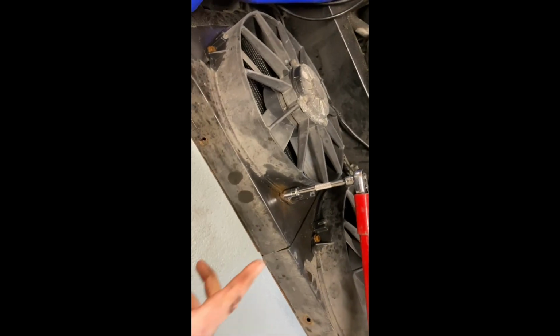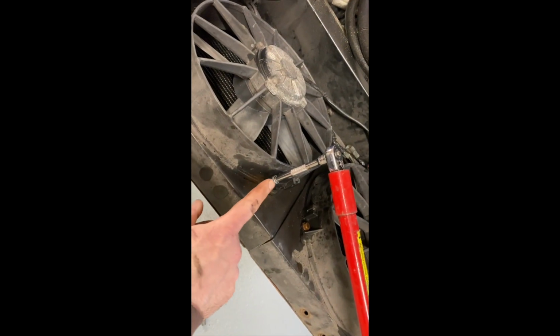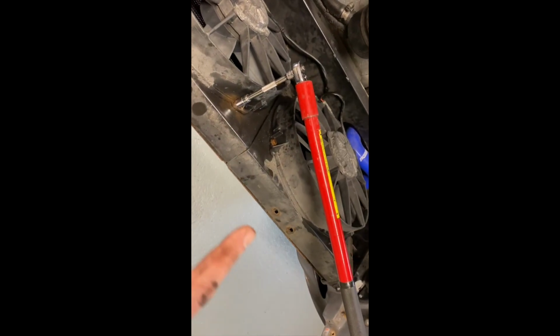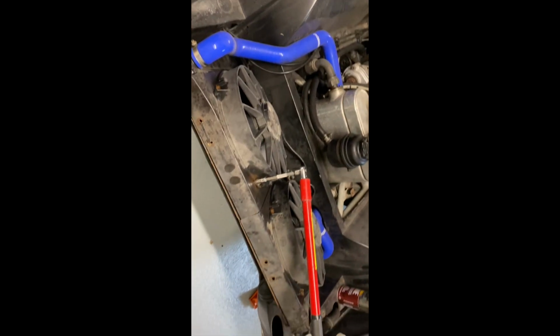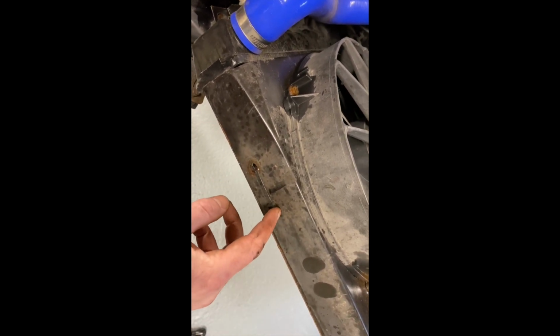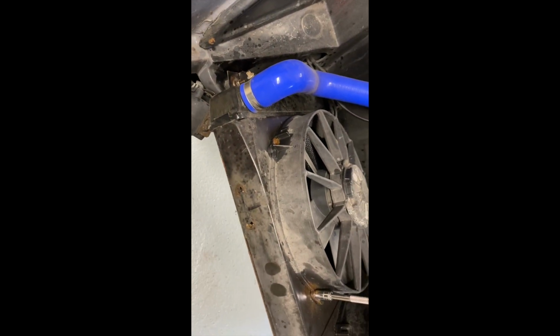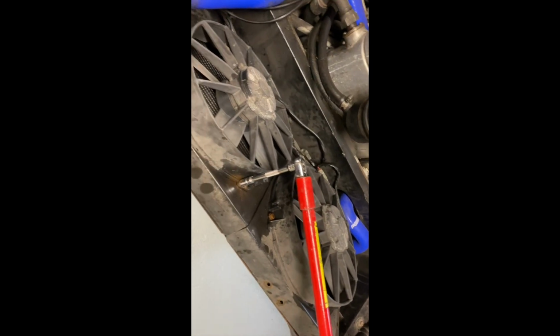Now I knew this bolt here, which was rounded, which should take a 10 like these, but wasn't. But I've managed to hammer a 9 on, just using the normal hammer after a bit of wire brushing, a bit more leverage so that I didn't put too much twist. It's actually come loose, because I knew once the radiator was off the car I'd never have this much leverage again with everything bolted into the car. And at some point these covers need to come off if I want to refurb them or whatever. I also noticed that I've got cable ties here, where a lot of other people, well, normal Tuscans I think, have bolts in each of these. Seen another video with a guy, I think another Rob like me, that snapped his off, because I'm not surprised, they're at the front, they're just going to rust and get knackered, so I can imagine that's why cable ties are in mine. Anyway, it's very rare I get a little success like this, so there you go.